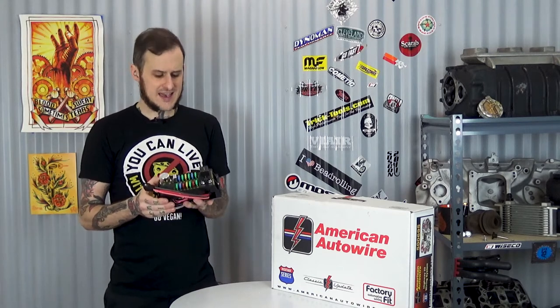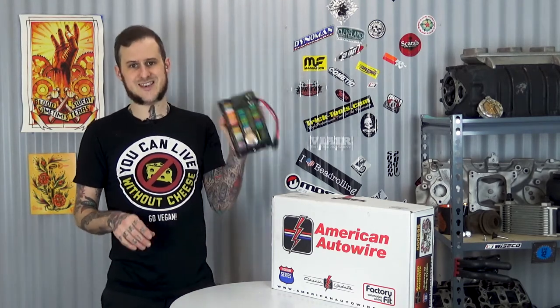So they're increasing resistance in the circuit. It means they're going to be causing problems in the wiring right off the bat, no matter what you do. And I've actually had them where I try to stick a new fuse in them and the ears fall off of the fuse holders. Well, now I'm up a creek. I can't use that circuit anymore. I have to bypass it. I have to put in an external fuse holder. That's no good. This is the way to go.